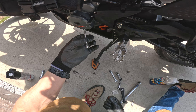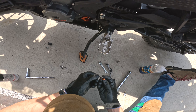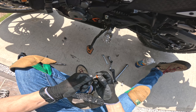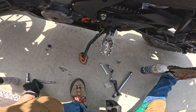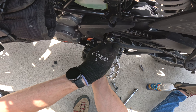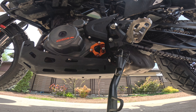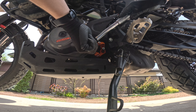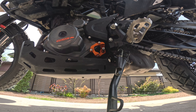Now we can go ahead and put on the engine casing bolts — the new ones with the washers — and get those torqued down. The long one goes up top. Finger tighten first. KTM 390 engine casing threads are just like cheese. Give these a little tighten before using the torque wrench. According to the manual, these two engine casing bolts should be tightened down to 12 newton meters. Let's get the torque wrench — it's already set. Two clicks, it's done. We are solid.